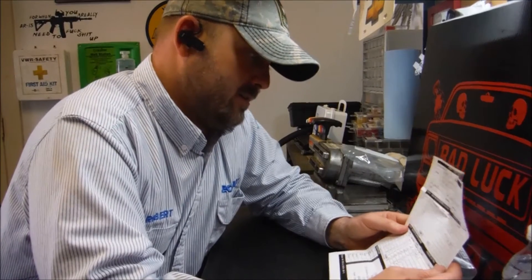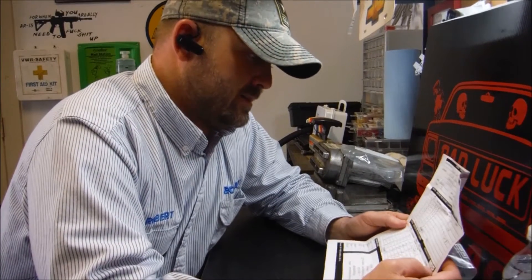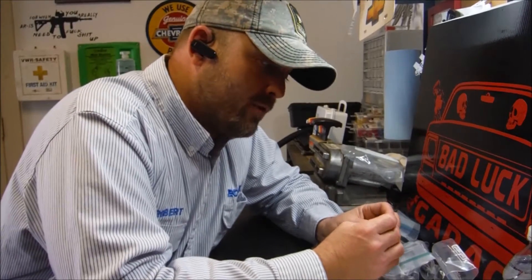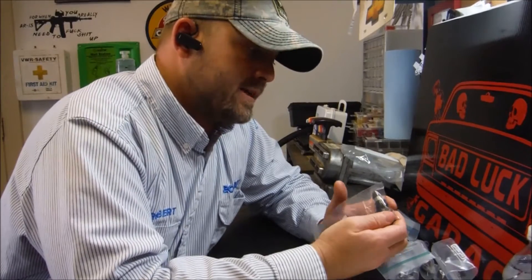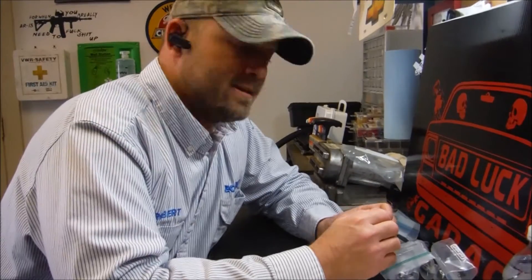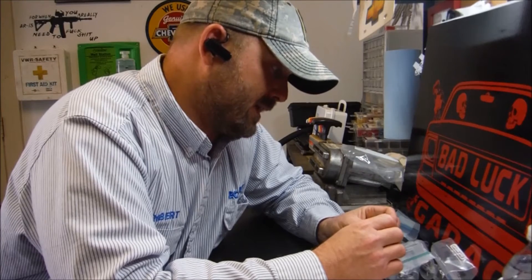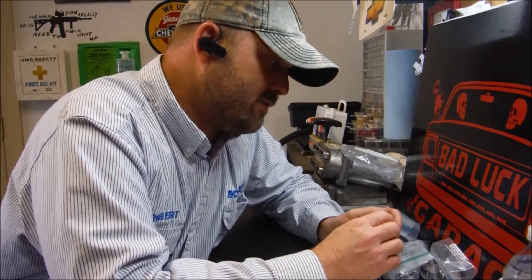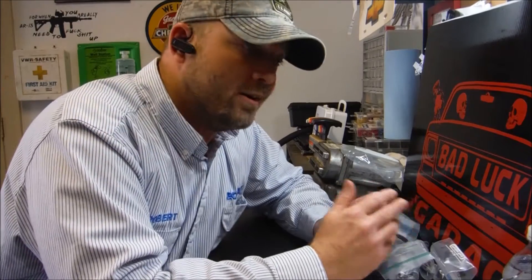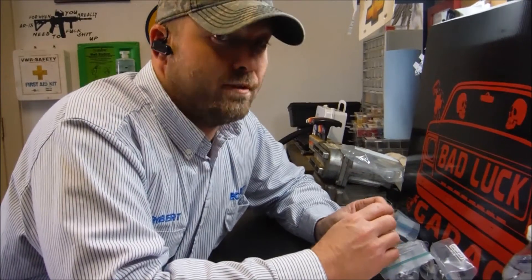That being said, we're not going to be using these right away. What I'm going to do — let's see, these are the 25317628s. Eric warned me about this and told me he'd rather I sent 16, because what you do is you decap 16 of them, have them cleaned and flowed, and pick the eight that are closest to each other. That's the perfect plan. I'm on a budget — I didn't have the money to get eight more injectors. Even though Eric told me it doesn't matter what the part number is, any of these truck injectors are going to end up flowing around the same numbers once they're decapped. But I'm kind of OCD — I want to send him more of the exact same part number.